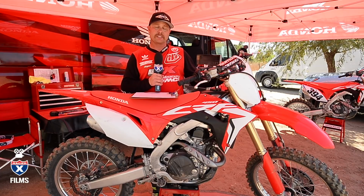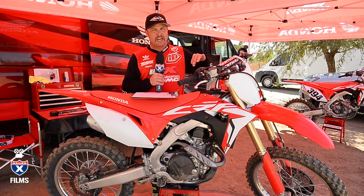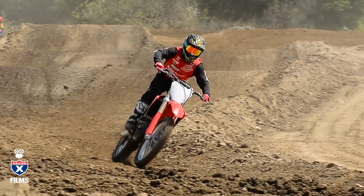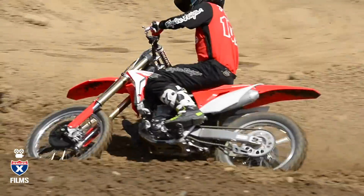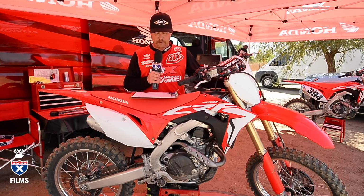The only time they liked it at 5 is places like Milestone here where it's stickier, tighter, jumpy, but no really high speed stuff or no hills. So today we're at 5, but again, definitely try 3 mil on that fork height. I think people are going to like that. And just for your own records, last year they were at a 4.8 spring, they're at a 5.0 this year.